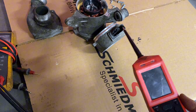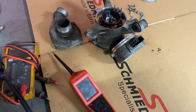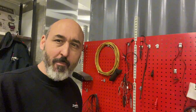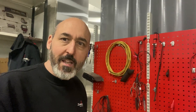Easy to check: have I got a live, have I got a live, have I got a ground — yes. BSD is something a bit different. These old BMWs you have to be really careful with the BSD. It's like a LIN line although the protocol is different. They don't use it anymore because it's completely unreliable — the slightest bad ground brings the whole bus down. On the N43 petrol engine, the BSD is connected to the oil level/quality/temperature sensor, the alternator, and the intelligent battery sensor.